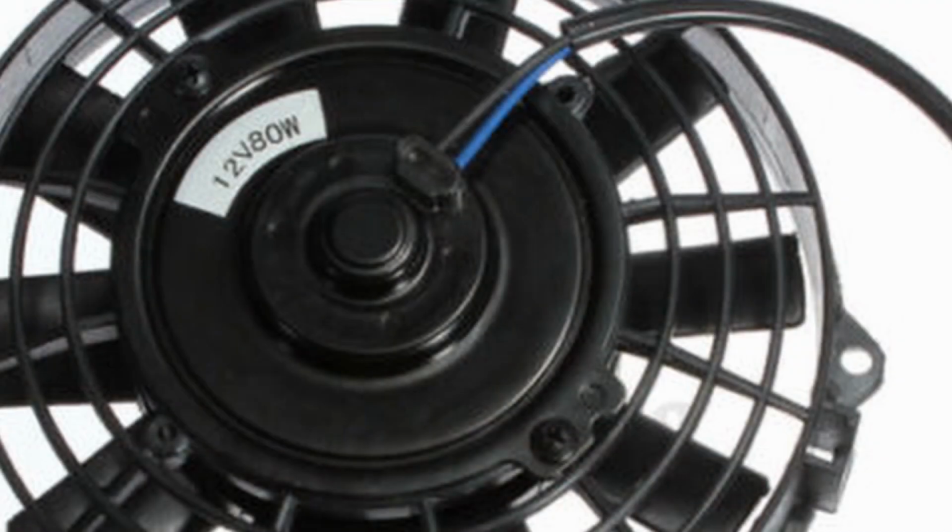Okay, just a little bit more about these radiator fans. The cheapest one on eBay, mine was a 7-inch. And you'll see on the label here it says 80 watts, which is about, what, 6.5 amps at 12 volts, isn't it? When I was first playing with this hack on the bench, I had a 5 amp PWM controller, and sure enough, it was struggling to start.